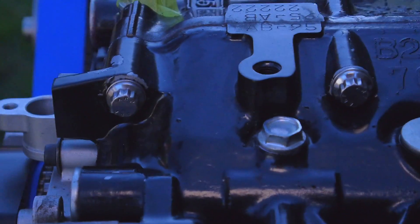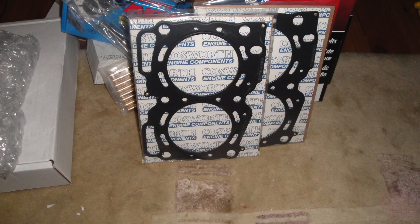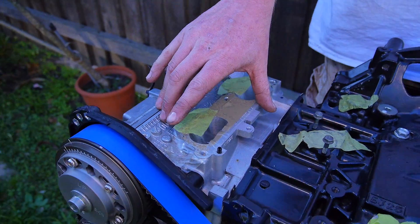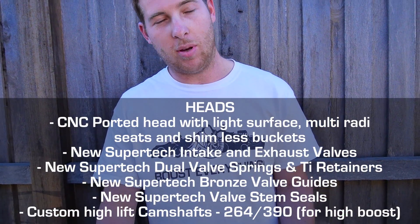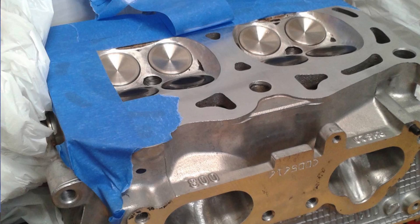We've got basically all ARP and Cosworth case bolts, main bolts, everything like that. The heads have been drilled and tapped for the Cosworth 14mm head stud kit, along with Cosworth head gaskets which have also been modified or potentially already came with the 14mm. Moving out to the heads — these are the only thing that weren't done by Cosworth. These were done by a company out of America — I cannot remember, I'll put it on screen — but these are a really, really high-flowing head. Basically this motor is built to handle 450 kilowatts at the wheels if you go crazy.